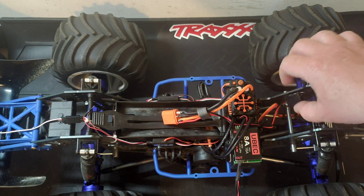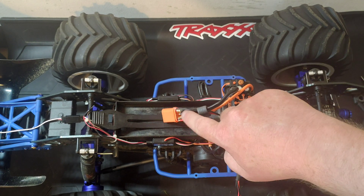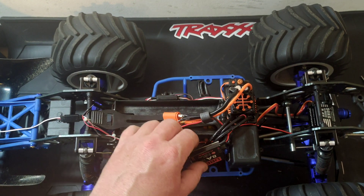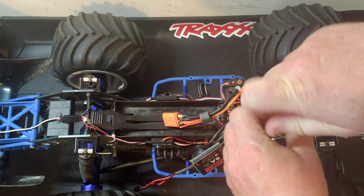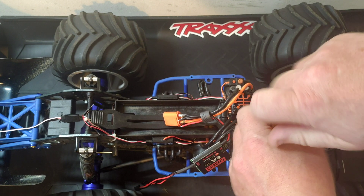There's not much clearance down the side at the body cage, so you're probably not going to be able to go that side. But you've got lots of options for places to mount it where it's easy to get to. One thing we're going to have to look at is the actual wiring for the servo itself, because you're not going to want to put the 8.4 volt back through your ESC.